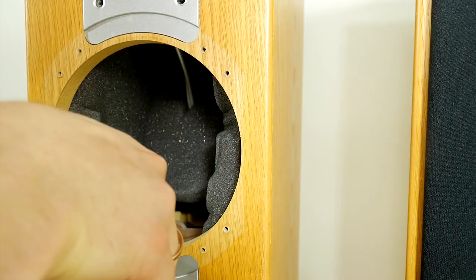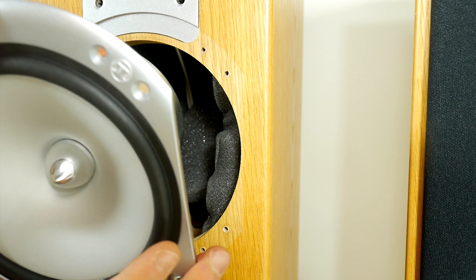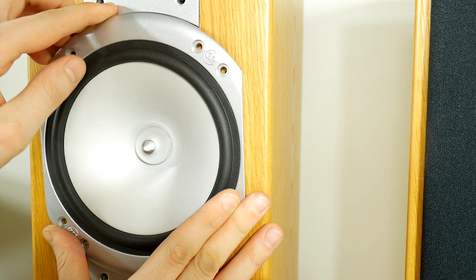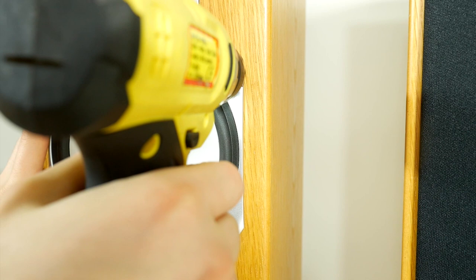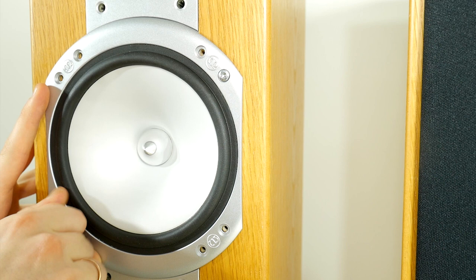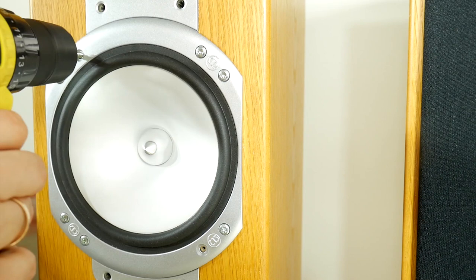Take the new speaker and connect the wires — it's important to connect them exactly the same as they were to the previous speaker. After this, put the speaker driver inside the housing. Since a broken driver was installed previously, it's important to remember the position of the speakers when taking them out, to install the new ones in that exact position. Insert the first screw but don't screw it all the way in to avoid bending the driver's basket. Insert the second screw — it's important that all screws are driven in the opposite diagonal direction to seat the driver evenly. Both screws should be tightened only when the speaker is seated correctly. Tighten all screws, but with care.